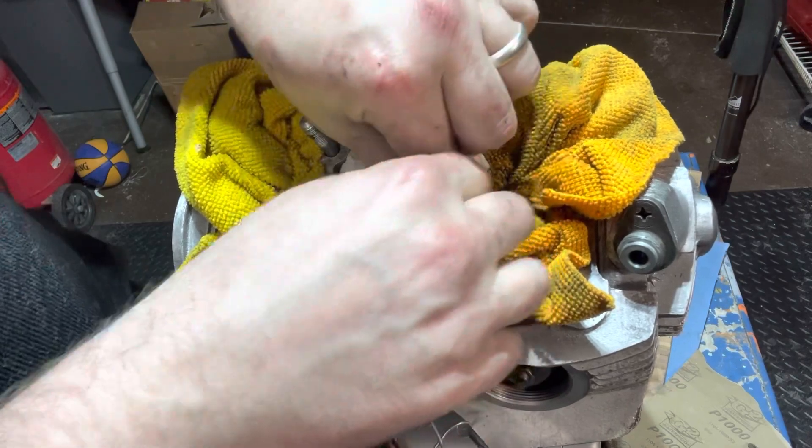Now with this chain in place, I can go ahead and remove these. We are exactly one tooth off. I'm going to go ahead, grab my connector very carefully, insert it just like that. Coming in here to put the side plate on. Got a little paper towel in there — I'm so paranoid. That is in. That is connected.